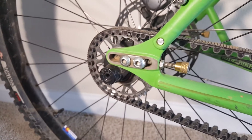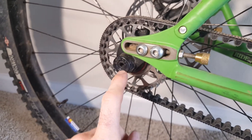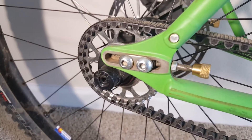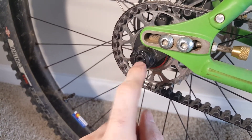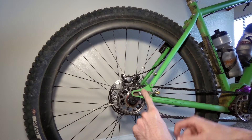One very important point: you do not want to take out your through axle before you undo the tension on the belt. If you do this, you will strip your threads here. I have done it. So we'll go ahead and loosen these guys.